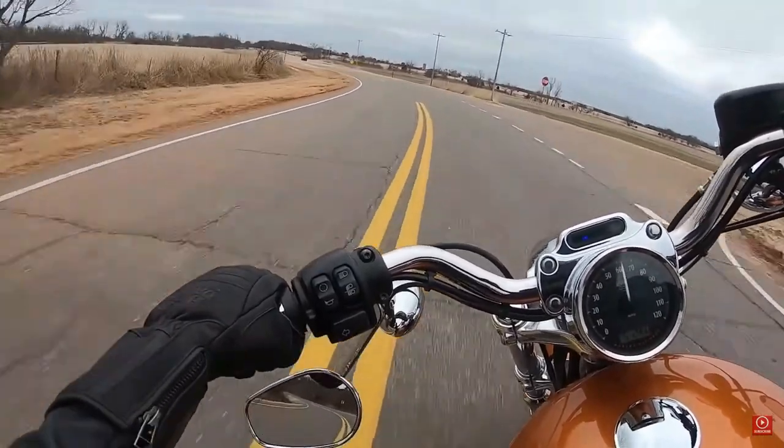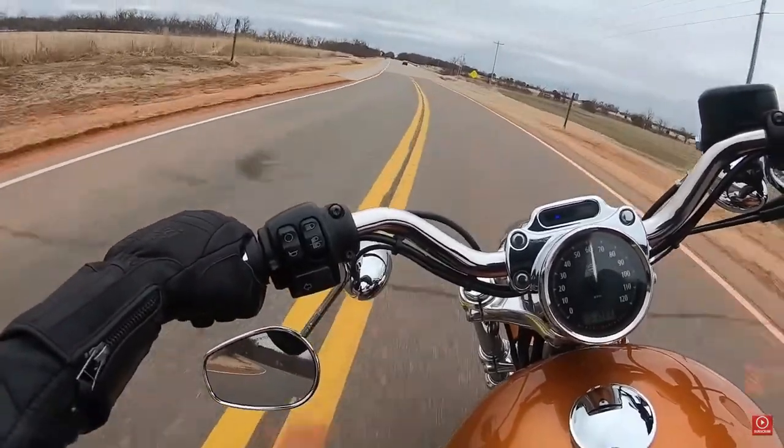And I can tell you from experience, these stabilizers, I've ridden rubber-mounted Dynas and some touring bikes with these on there, they do not destroy the ride of the motorcycle. But when you really start getting into the curves, you can definitely tell that it makes the motorcycle more rigid. You don't feel that flex and that walk like you originally did when you're going into the corners.